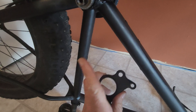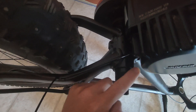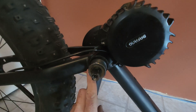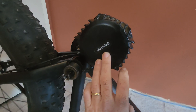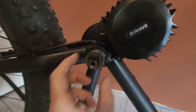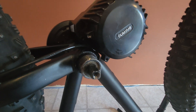It really comes down to two things: number one is making sure that it is perfectly flat with the bottom bracket, so there is full surface contact with this part; and the second is putting it on with a good 80 to 90 foot-pounds of torque and using a torque wrench to verify that. I haven't had a motor come loose at 4000 watts or at 1500 watts on any of them, so it's a case of making sure there's a good solid contact, and I'll talk about some other tips for that as well.